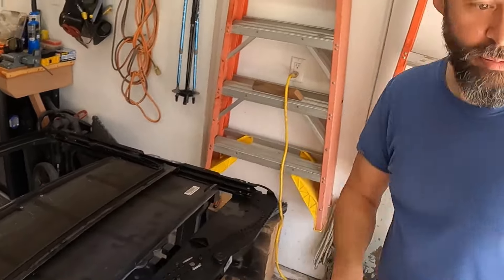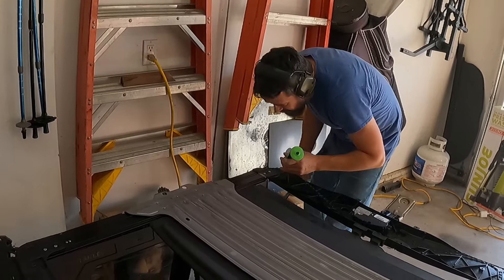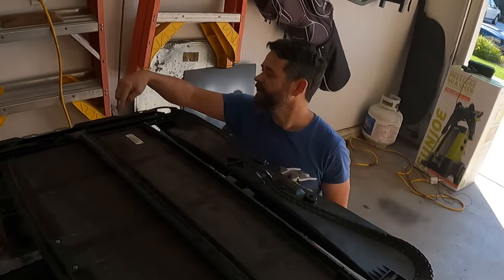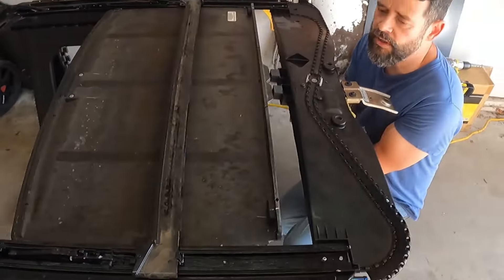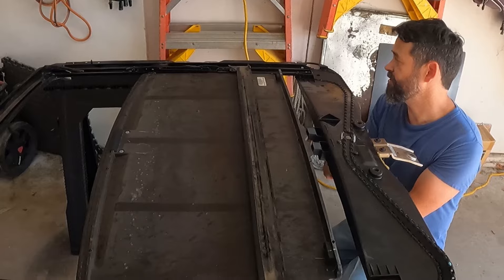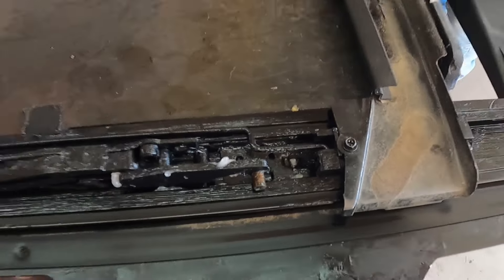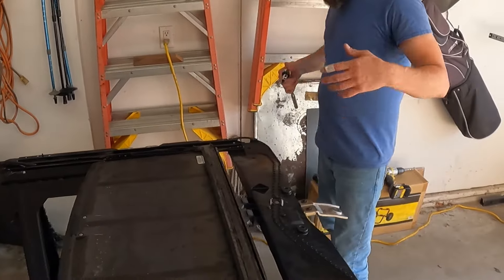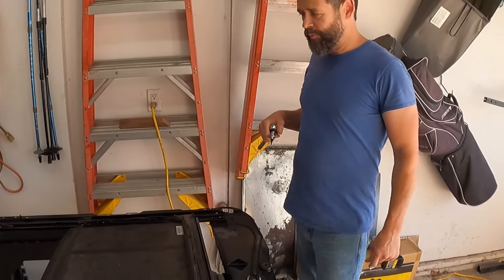That's why it's good you watch this first. Let's flip it over and punch those stop tabs, then complete the test. We just wanted to show you up to this point — it wasn't far, we don't want to go too far. Now that we've done that and flipped it back, the tabs are up as they're supposed to be. We'll finish running this all the way back. The final check: are both sides at their stops and even? Hit the stops. That feels good on both sides. Now we run it all the way back to the end, then it's time for install.